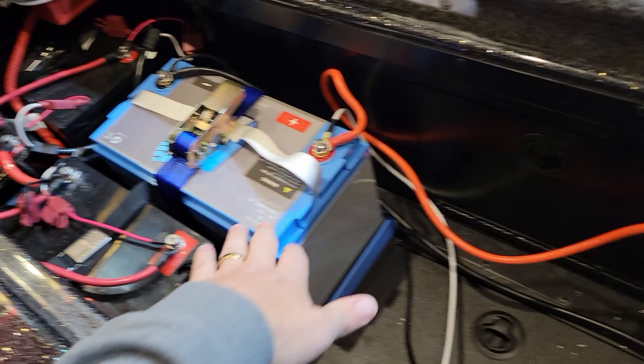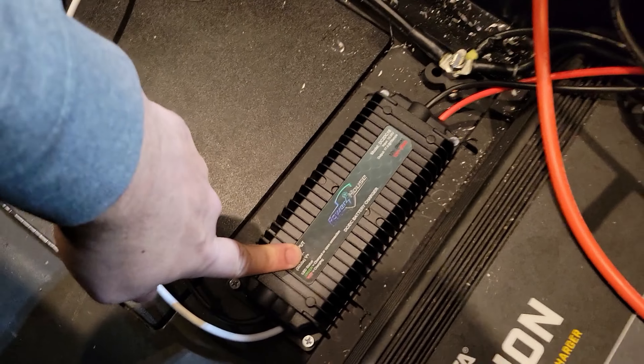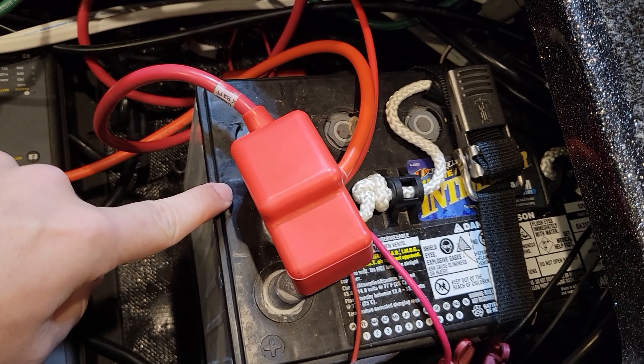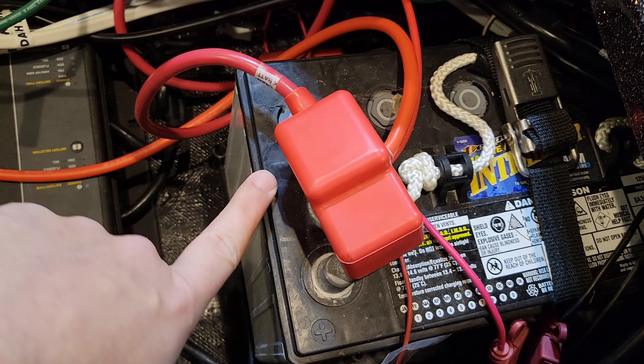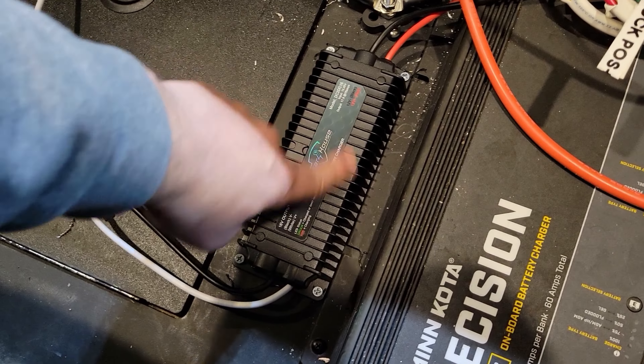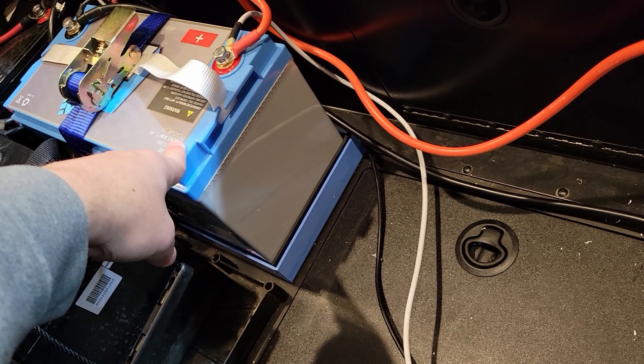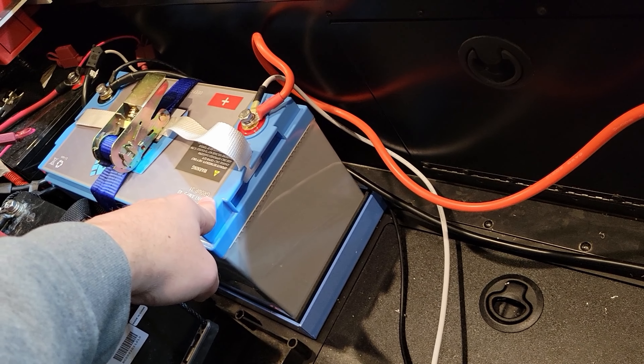Installation is just about done. We got some cleanup and some wires to clean up and wrap up. But we have added the Powerhouse lithium 16-volt 80-amp hour to run the electronics. We've got that running on a run-and-gun system from our AGM starting and cranking battery. So basically the leads come off that into the run-and-gun, and these ones go to the Powerhouse lithium. So basically whether I'm running my outboard or my Minn Kota charger, once the AGM is charged it overflows through here and charges the lithium — that's redundancy and lots of extra power for my units.